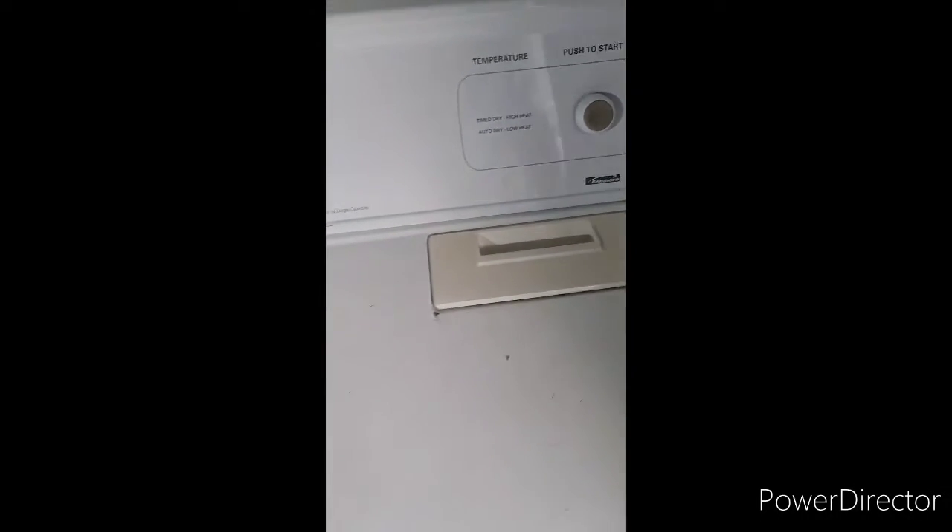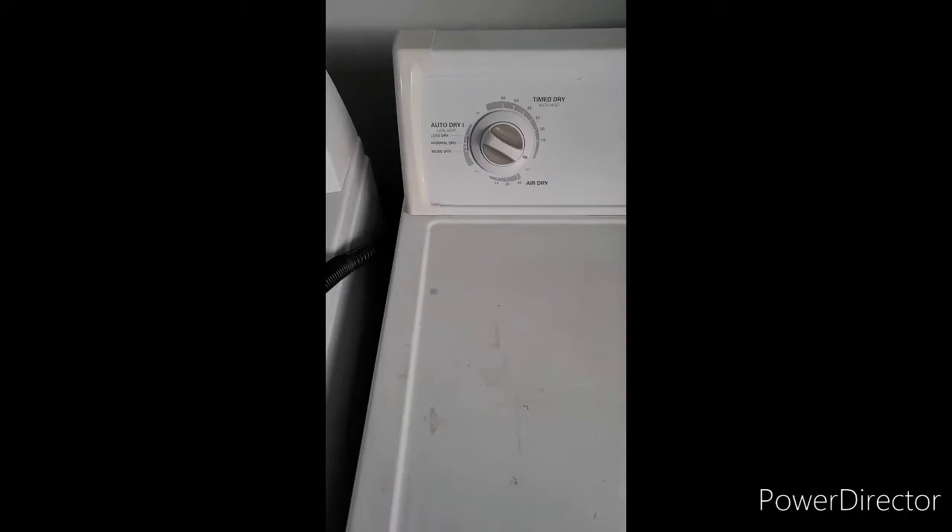So here's a look at what I have — a Kenmore dryer, it's electric. You can typically use this guide for Whirlpool dryers as well because they have similar setups. There are five parts on here that could be the culprit of not allowing your dryer to produce heat: it could be the thermal fuse, the cycling thermostat, the thermal cut-off — better known as the high limit thermostat — the heating element, or the thermostat itself. We'll take a look at each one.